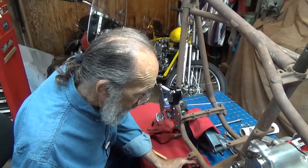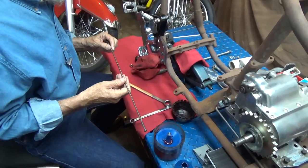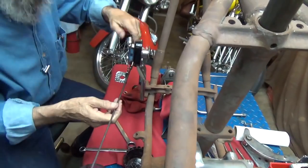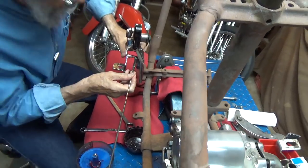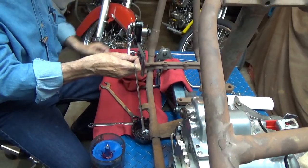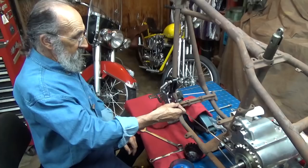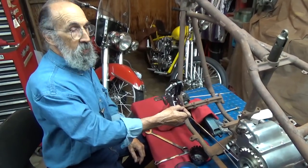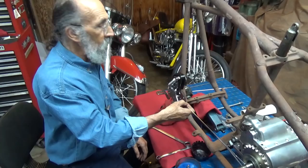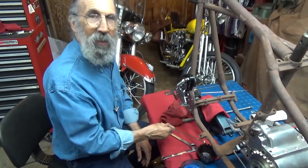Other than that, I don't know if we have the right clutch rod or not. As I recall there are at least three sizes and I have all of them here — they're all represented here. But this is how it will be when it is in position, and the rod will go back to the arm that comes across the transmission. So for now there it is. I hope you enjoyed that as much as I did, because that makes me feel real good. So we'll be doing more of this stuff. I may get into that rear fender and oil tank here pretty soon, so we'll keep building with what we have while we're waiting for other things. Until then, see you out on the road.